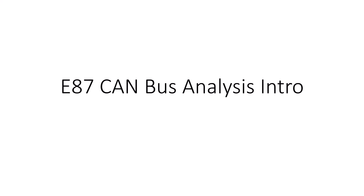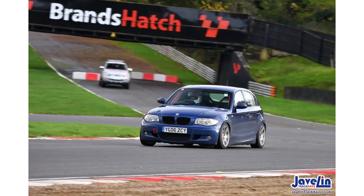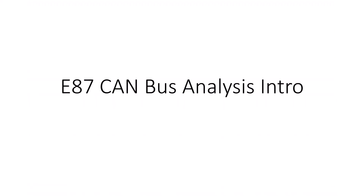Just to give a bit of background in case you haven't been following my race car build series on YouTube — I'm building a car to compete in the 116 Trophy series here in the UK. The car is stripped out, and two things you do take out are the parking detector ECU that sits in the boot and the airbag unit. All the airbags, seat occupancy detectors, and seat buckle detectors have been removed because I'm running a racing seat with a full harness setup. The result is that when I start the car, I get an airbag and seat belt warning light.